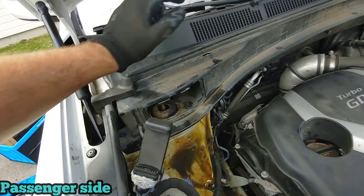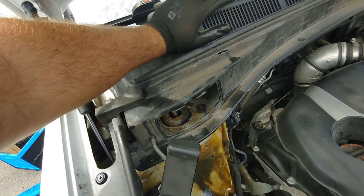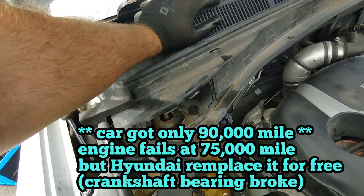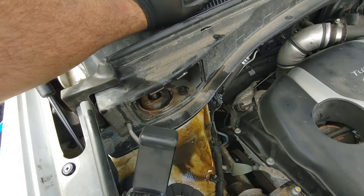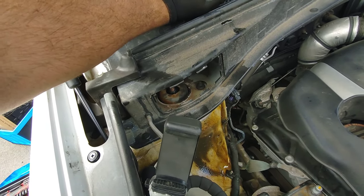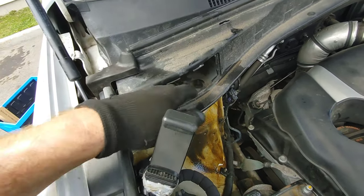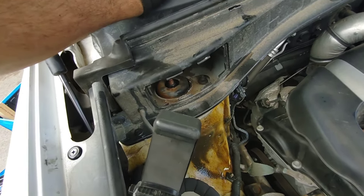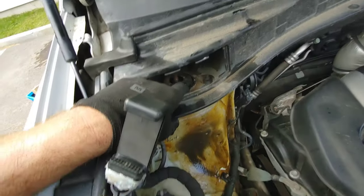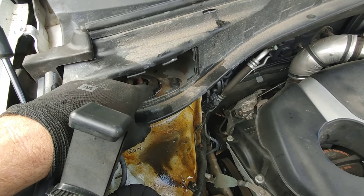Okay, so when I'm driving the car, I really hear the sound coming from the bottom of the car, under the engine or something like that, but more on the passenger side. It's really hard to tell. But I try again to film the strut on the passenger side, and I realize that there's a kind of spring noise. So I suspect the strut now, even if it looks great under the fender. So now I'm gonna film the top of the strut. If the bearing is bad and it's what makes the sound, I'm gonna know it like that.